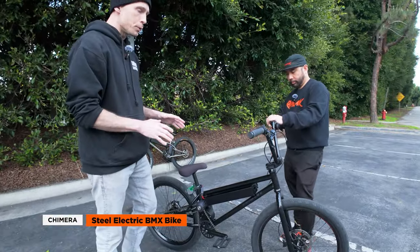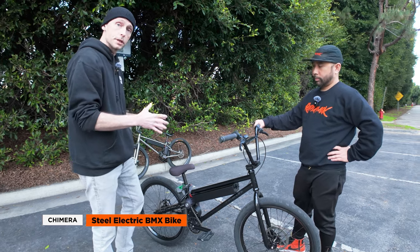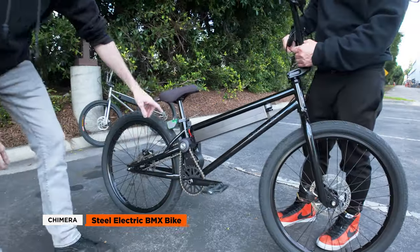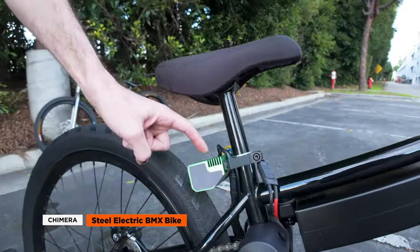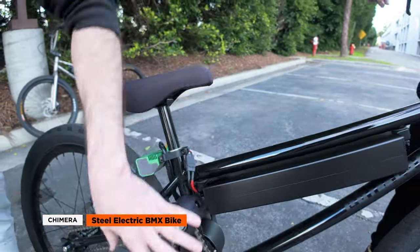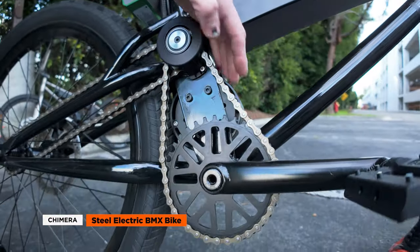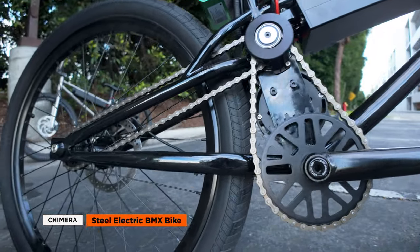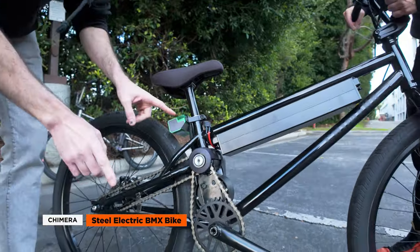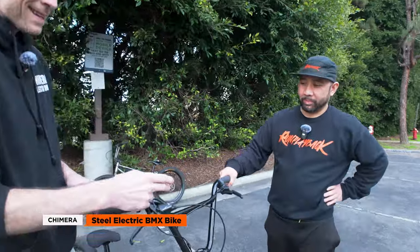This is the new Shadow Chimera. We just launched this product on Tuesday and it is meant to be the more affordable version of the titanium Chimera that we've been selling since our successful Indiegogo launch back in 2022. It comes with an Accelerated Systems BAC 855 controller — you probably know that brand from the controllers that soup up Sur-Rons. It comes with our proprietary high-drive powertrain, which has an in-runner motor capable of up to 5,000 watts. We run it at 3,800 watts stock, with a silent instant-engagement transmission on either side, which allows the bike to be pedaled like a bicycle or throttled like a motorcycle. It also comes with Magura CT brakes.